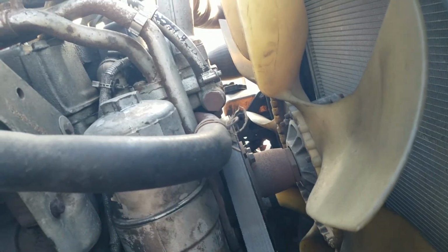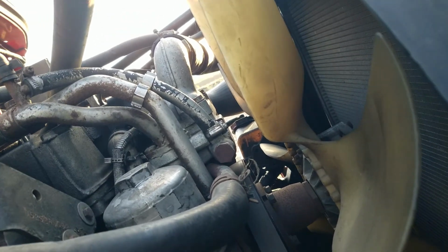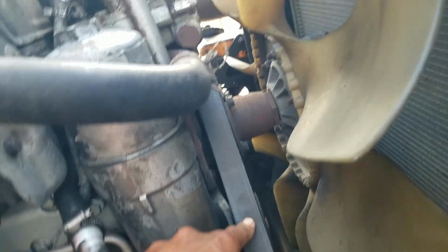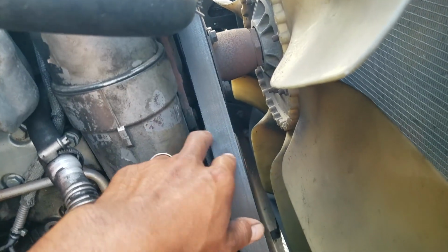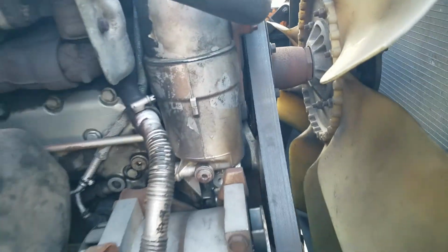Then we're going to check our water pump, making sure our water pump is safely, securely mounted, not damaged, not leaking, and the water pump is also gear driven. I'm sorry, it's belt driven. So we're going to go ahead and check our serpentine belt again, making sure it's safely, securely mounted, not damaged, there are no cuts, cracks, or frays, and there is no more than 3/4 inch of deflection. And that concludes our pre-trip inspection.